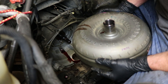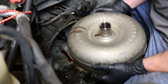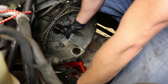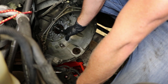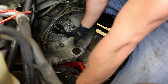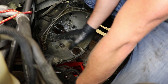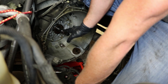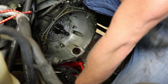And she's out. There will be a little bit of spillage — that's normal. So I'm going to get this out and then get the new one ready. This is a good time to take a look at the seal and make sure everything is good. It is a good idea to replace the seal. Now I'm not going to replace the seal on this because I did have the transmission fully rebuilt, I think about two years ago or so, and I don't know how long this transmission is going to last anyway with the cam and all that. So we're going to do our best but that seal looks fine for now. But if you're in there and you're not planning on putting a new transmission anytime soon, I do recommend replacing that.